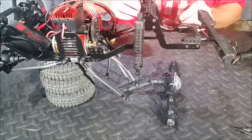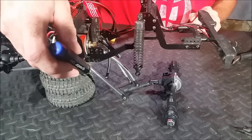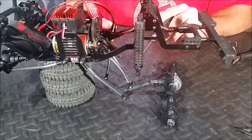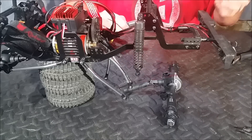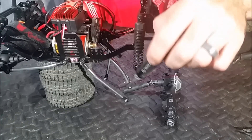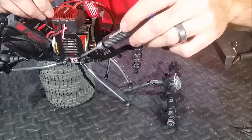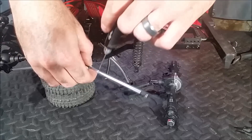Let's get this rear axle installed. The first thing you're going to want to do is remove both of these lower links and turn them around. Initially this bend was very close to the axle, but when you install them that way, your links end up hitting the frame when the suspension compresses. I wanted to go through this now so that you don't have to go back and do it after you complete your installation. Once you take these off, take these little inserts out and swap them front to back — this one has a big space to push it out further, and you want to make sure that spaced-out piece stays up at the front of the frame. Once those are swapped, rotate the link 90 degrees so that the bend is moving away from the frame.